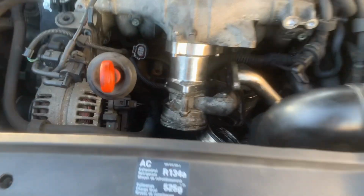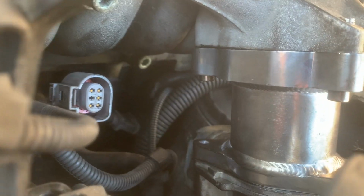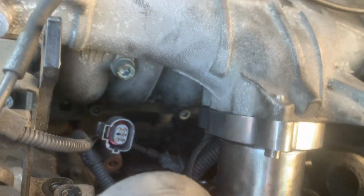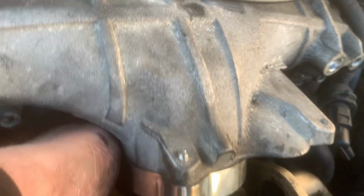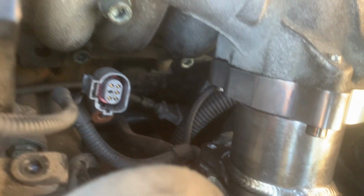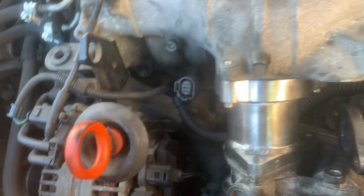Alright, so that's on. The long bolt around the back isn't a problem once this is on, because as you can see, you can get directly to it. Just obviously need to put the bolt in there now to hold the anti-shudder valve up. Do that up tight. These ones did up nice and tight. Looks alright, not going anywhere.